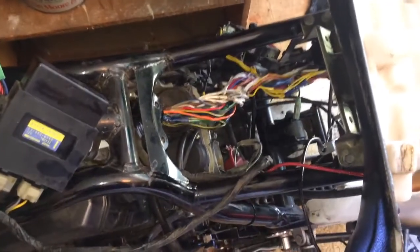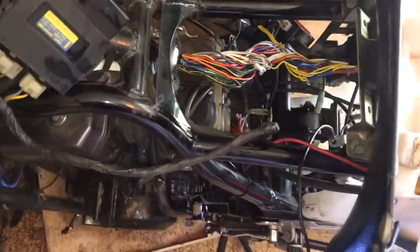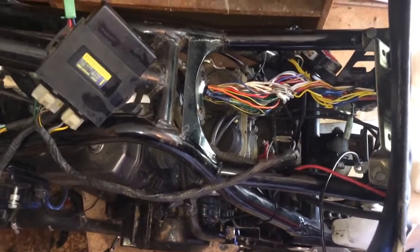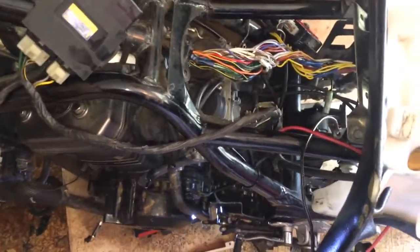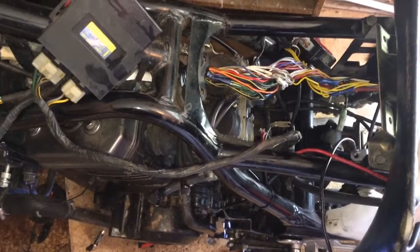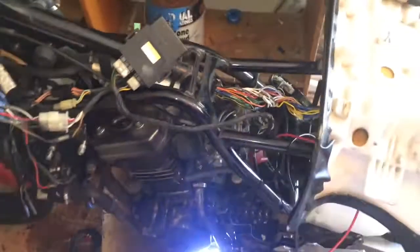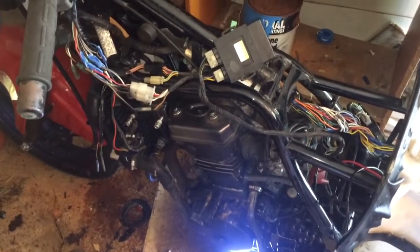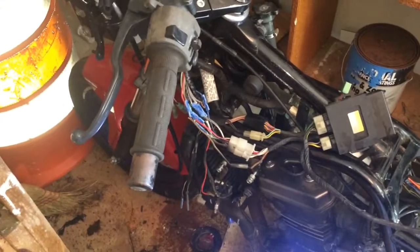I'm going to test the electricity from the magneto to see if I'm actually getting anything while turning it over. It actually is turning over. Next step is to take the carburetor off and clean it, because with all the rust that was in the gas tank, petcock, and reservoir, I can guarantee that 20-year-old carburetor is trashed. I'll need to clean all the jets out. If you like my videos please subscribe — this is the '97 Kawasaki Ninja 250R project. I think I can get it back up and running for around $200, probably including a new wiring harness.